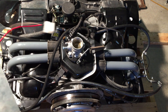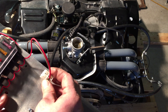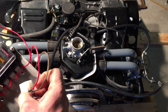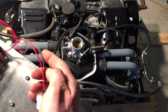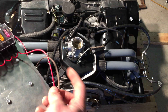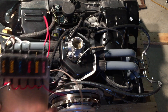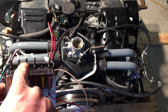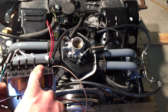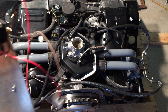Fuses here, and we've got this connector for the relay board. It goes where the original fuel injection wiring went — plug that in. It's got the ground turn-on for the fuel pump in there and then the power supply for the whole unit. You can see it just comes in and piggybacks to all these fuses. The fuse positions: we've got two for injectors, the coil, idle air valve. This blank one is where the wideband O2 sensor will go. And then this lead goes to the ECU and has the main power.